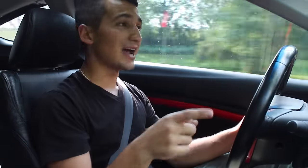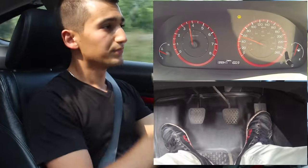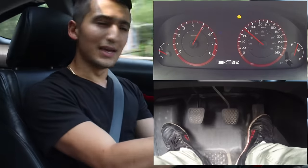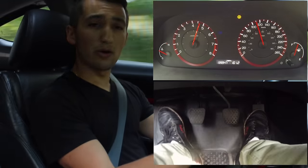The beauty of this technique is that you get to go faster when you're driving at high speed and high RPMs. If I want to use my entire RPM range and redline at 7,200, going from second to third, if I don't double clutch I won't be able to engage my next gear very smoothly without ruining your synchros. You can just throw it in gear and mash it in there, but you're going to be ruining your synchros. If it's not your car, who cares — but if it's your car, you want to baby it. Double clutch downshift just like that, and then double clutch as soon as you hit RPM. See how I was able to do a fast shift?